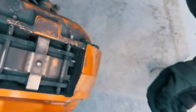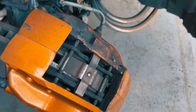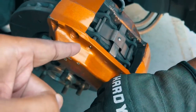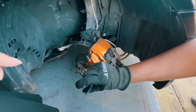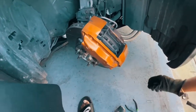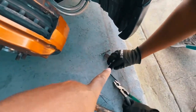My brother's telling me there are two pins inside the caliper right here — a little hole — and it's two actual pins that slide in. What you do is take these pins out, and then get something thin and pop it out with a hammer from this side. This little lever piece has to come out. You've got to do both of them almost at the same time, because if you try to pull one out, the other side develops a lot of tension. We're just using a hammer to get it in there — see how that's slipping out, it's already starting to come out. Boom, slide out right there — just pull it out.